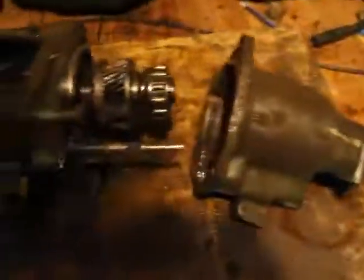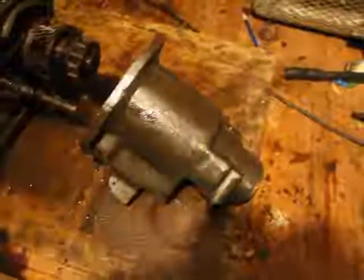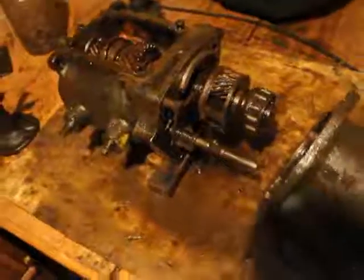Then once it starts opening, I used a pry bar like this here, right? And then you'll do one side and then the other side. If you try to just do one side, it'll warp it that way. So as you push one side out, the other side will go back in, if you understand what I mean. So if you have a helper, that certainly helps. You can have one pry bar on this side and one pry bar on the other side, and both sides will come out. But if not, just one side and then the opposite side, and then up and down, opposite sides like that, alternating. And then it will come. And obviously, just drenching it with oil. That's what I did. And you can see there's no marks, no scratches.